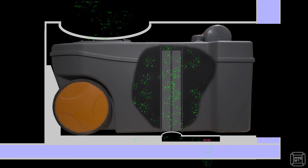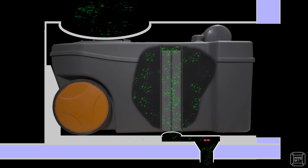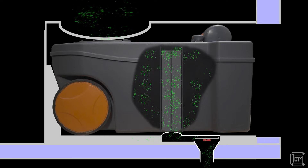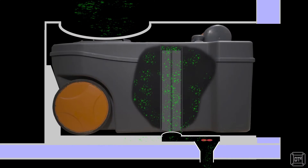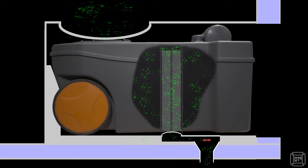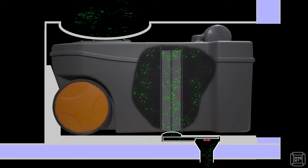The ventilator fan works by adding a small electric fan into the system along with an external vent tube down through the floor via a supplied charcoal filter. The kit includes a modified control board which automatically activates the fan whenever the toilet is flushed. So with the ventilator kit fitted, as soon as the toilet is flushed, the airflow is going from the bathroom down through the toilet and out of the van, making it almost impossible for any smells from the toilet to enter the bathroom.